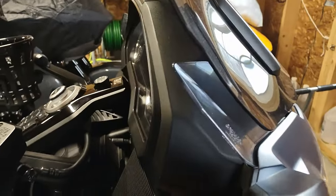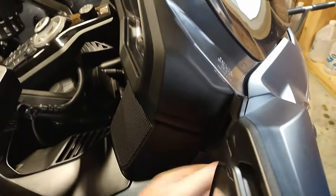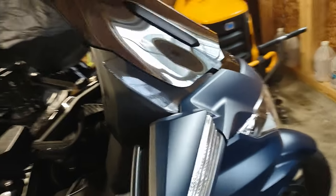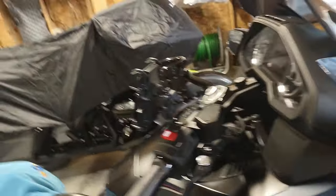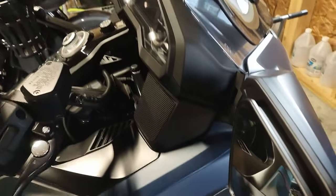There's a five millimeter screw right here — this whole plastic under-panel comes off on the mirror, and then there are two bolts and the mirror pod pops right off. Once you get this panel off, there'll be two bolts in there. You can pop those off, disconnect the line, and the mirror will literally just pop right off.